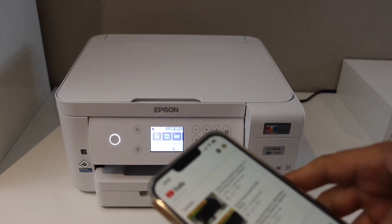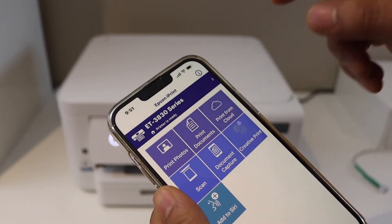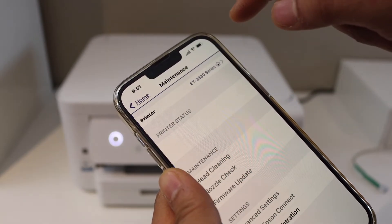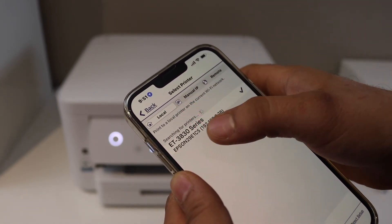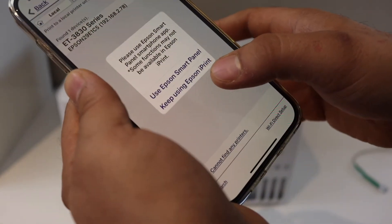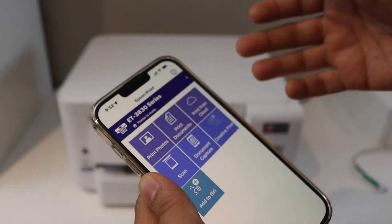For example, I am going to use it on my iPhone. Go to the Epson iPrint app — you can download this app from the App Store. On the top you will see a line displaying the printer name; select it, click the home button, and it will display your printer series. Select this printer and select 'Keep Using Epson iPrint' — it will instantly add the printer.